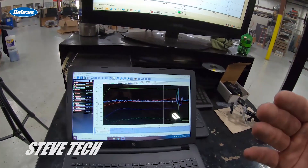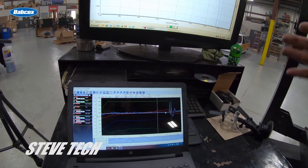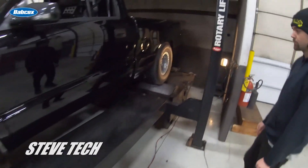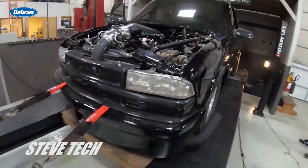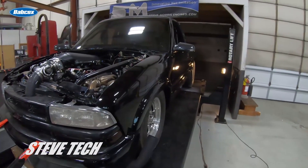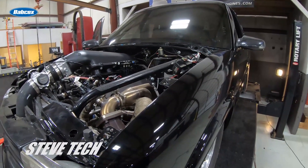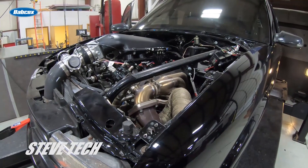Another good safe pull — we've moved up a little bit. Now we're going to go a little higher RPM and put a little more boost at it. We always do this with initial pulls: short pull, a bit longer, then longer, always sneaking up on things. Making sure the straps are tightened down — they can loosen up, so we've tightened them a couple times already. Once they take a set they seem to stay. We'll keep working on tune and do a spark plug read. Good opportunity with a brand new combination.